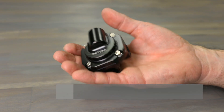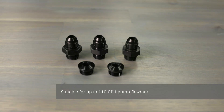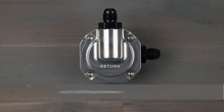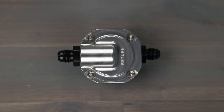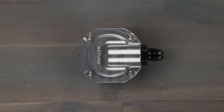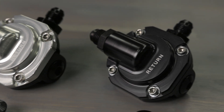But don't let the small size fool you — the billet aluminum body features three 6AN fittings and even includes a plug should you need to plug a port or two. It's also clockable so you can adjust your fuel routing, and being that it's preset at 59.5 PSI, it's perfect for most EFI systems. These are anodized in clear or black for corrosion protection and good looks.